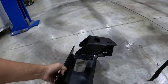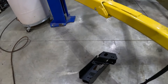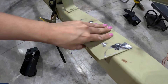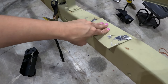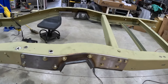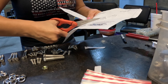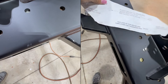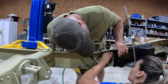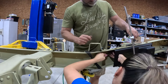This is our piece, and this is for the left side. The front bed rails — we've got to remove these, and then that basically goes on top in this position right here. That's what we're up to. Once that's finished, we can continue on installing the quadrilink. Once we took off the bed brackets, I used the template from the kit to locate the new drill holes for the chassis brackets. Once they were in position, we used clamps to hold it to the frame while we drilled the four holes on the outside of the frame rail and six underneath the rail to bolt the brackets to the frame.